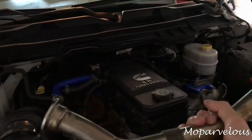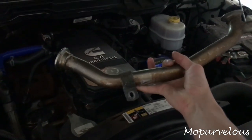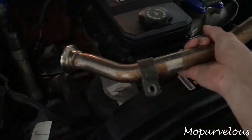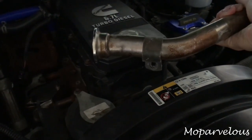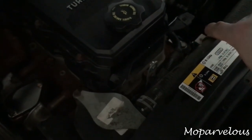What that intake does is balance the ratio of exhaust gases to fresh air, so now the only source of fresh air is the ram airbox — we don't need to mess with the throttle valve. One thing I wish I would have known is that this crossover tube is going to be a nightmare to get off. It sits in there and you need to disconnect it from the bracket — there's an eight millimeter bolt, and there's a bolt on the other side, but that one is actually welded onto the bracket. Disconnect the crossover tube from both v-clamps on each side, slide the tube out through the bracket, and then you can get to that eight millimeter bolt. It literally took me almost an hour just because I didn't know that bolt was welded.